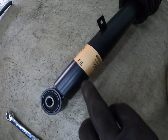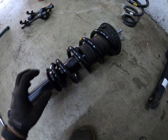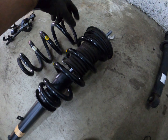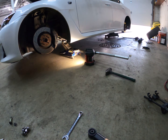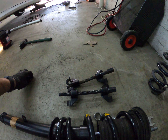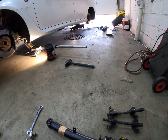There's a difference between front left and right — 'F1L' just for the bracket for the brake line; I think that's the only difference, because on the other side it's the opposite. Yellow-yellow on the front — the old fronts were yellow-white, same with the rears. That pretty much concludes the video. You'll probably need a spring compressor, something cheap, just to get the fronts, because you have to compress about a half inch to an inch to get the nut on.